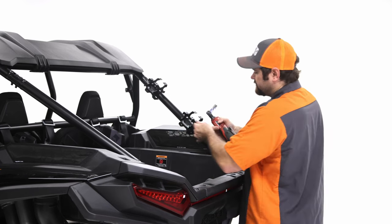So go ahead and close the gate and actually lock it or engage it, okay? And this will kind of set where that hinge plate needs to be, or excuse me, the receiver plate needs to be. You're just gonna go ahead and tighten down those bolts all the way. So once you have that tightened down, just make sure that it functions right. You should be able to just close it. It engages really nice. You can unhook it. So just double check and make sure that everything is installed there.